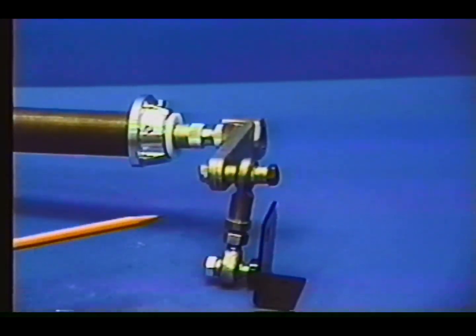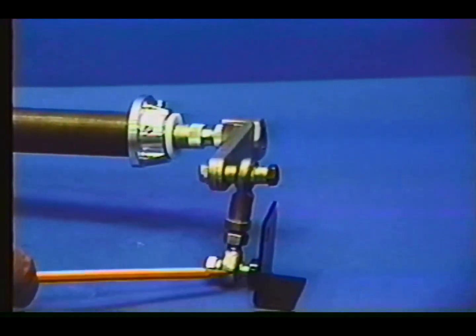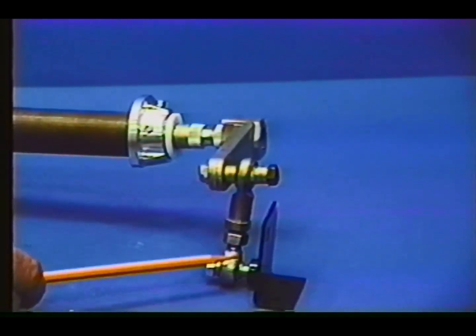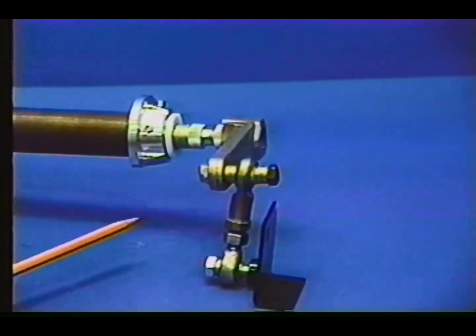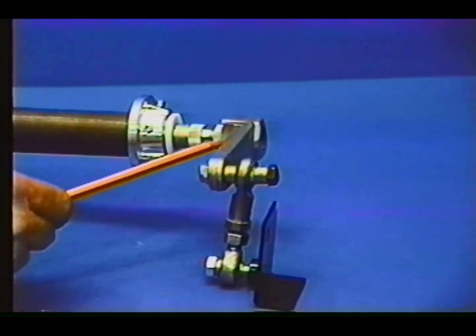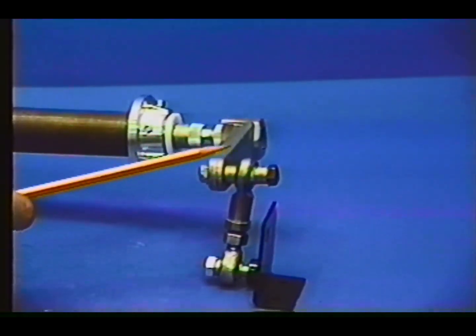To check for correct rod end adjustment, there should be a small amount of free play in each tie rod end, with the rider seated on the machine. Again, to accomplish this, either lengthen or shorten each tie rod end, tighten the jam nut. The bar arms should also be parallel with the rest of the machine.